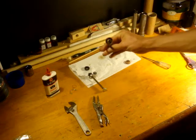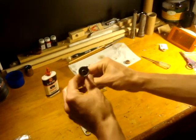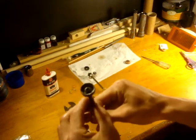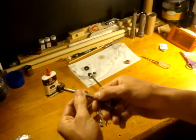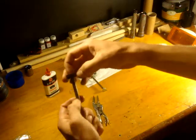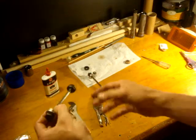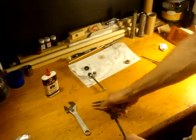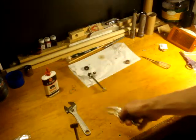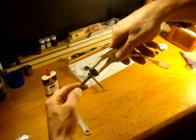On the pump — on the older pumps — there will be a square nut on the inside. I'll show you a little better once I pull it off. There will be a square nut on the inside and then a hexagon type shape as a backing plate to the cup. What I typically use for this is a pair of vise grips and an adjustable wrench.